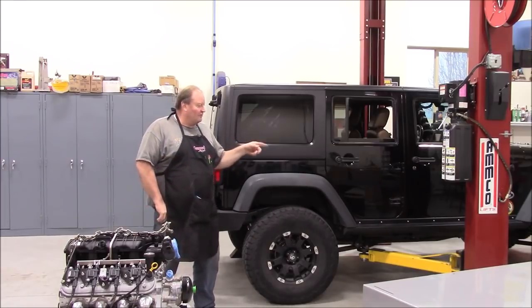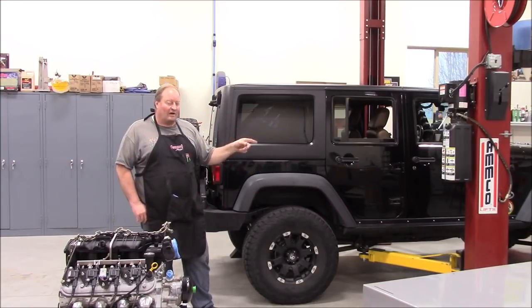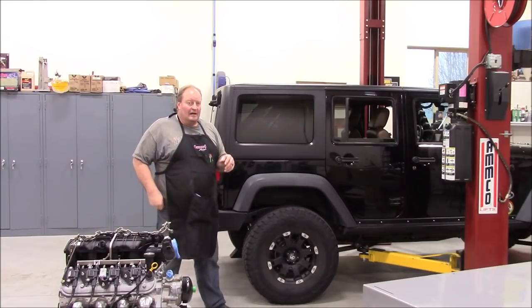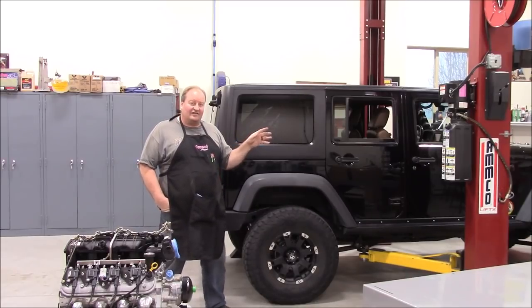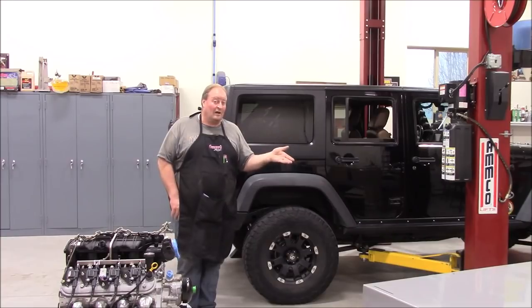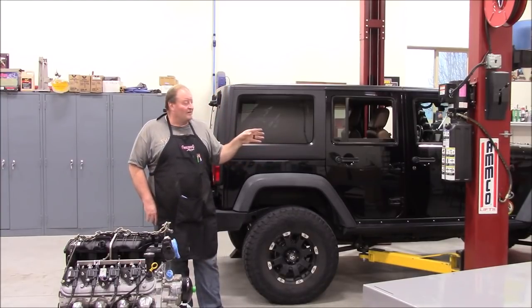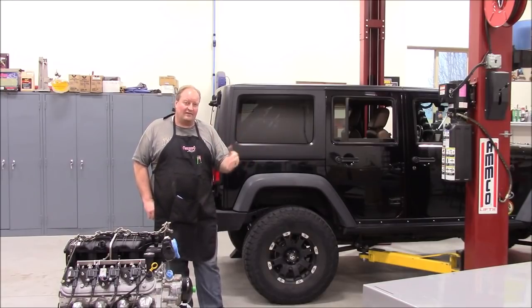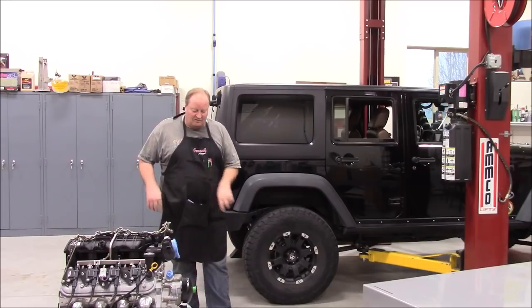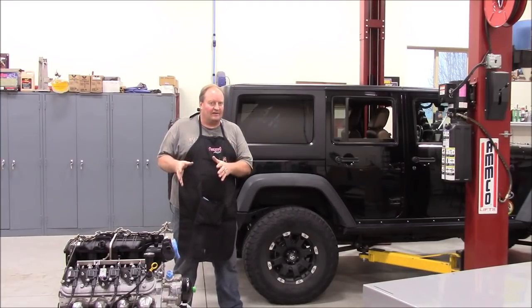About two weeks ago I switched over and put 4.56 gears in my front end, and also did a drag link flip to accommodate space for my hydraulic assist steering. I had originally been running the PSC XD2 gearbox. About four years ago when I first started looking at this swap, the PSC XD gearbox was compatible with the LS, so I put it in about a year ago — not knowing there was an XD1 and XD2 that were different sizes. The PSC XD2 gearbox will actually interfere with the AC compressor if you run the JK accessories on the engine.